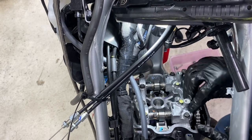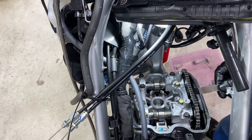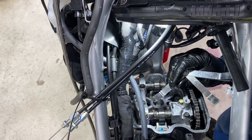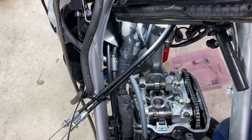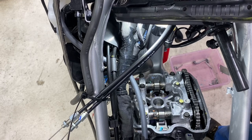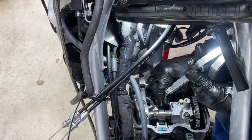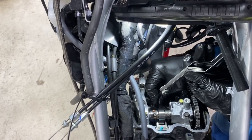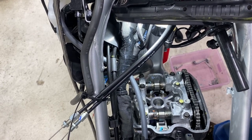We've got our cam bridges on, all torqued down, so we're doing our final check. I've changed the intake shim. I'll try to put a 0.179mm feeler in — just won't go. So we'll try a 0.152mm — that's nice there and firm there. So that's around about 0.16mm — they're perfect. We'll go to the exhaust side, which is 0.27mm.